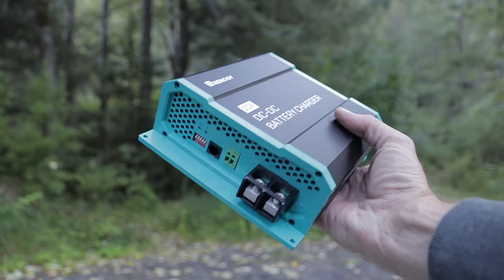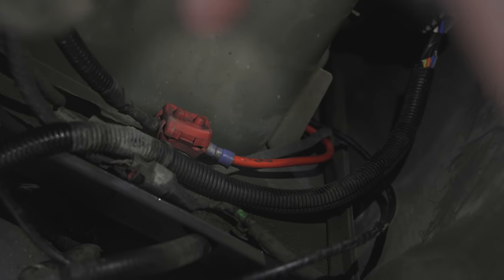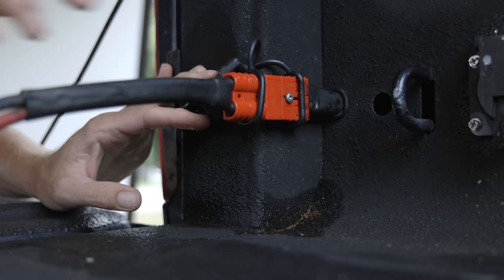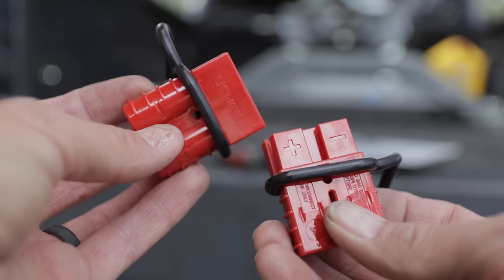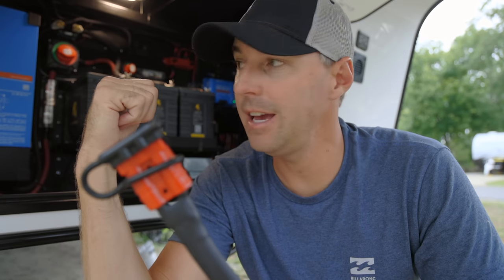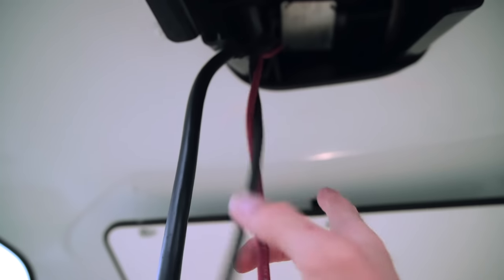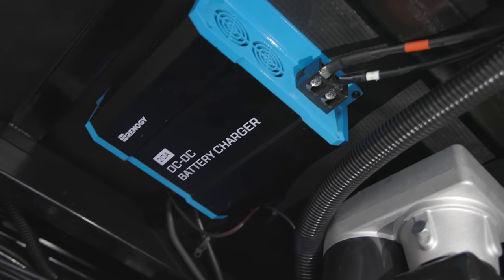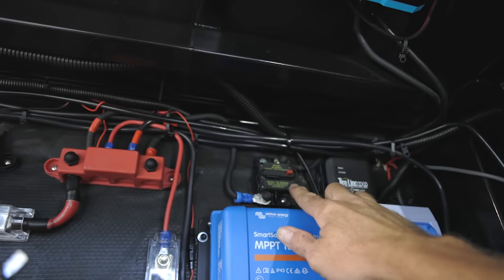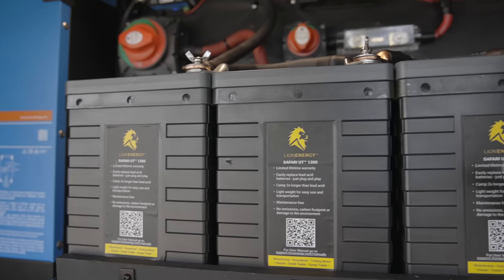For the install, we have a number-six gauge wire that goes from the truck battery to the bed of the truck, with a quick disconnect and a 30-amp breaker in line. The other side of that disconnect connects to the RV so we can plug in for power — I'll put a link in the description; they're really handy and easy to use. This one is rated at 50 amps, and they have versions rated well over 100 amps, so get one the proper size for your setup. We ran the wires along the inside skin of the fifth wheel, then into the DC charge controller. On the output side, the positive goes through a circuit breaker to the positive bus bar connected to the batteries, and the negative goes to the negative bus bar.